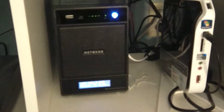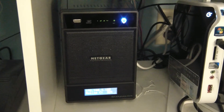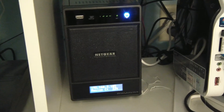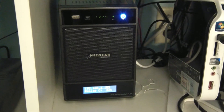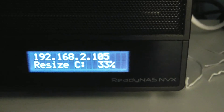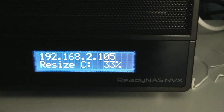What I want to show is how it behaves. Here's the beast right here. When you replace disks one at a time, like you're meant to, if you want to increase capacity — so you pop in one bigger disk, let it re-sync, pop in the next one, let it re-sync, all the way through the last one. When you're done, you reboot it, and during the next start-up it figures out that there's more space to use, and so it'll start resizing the root volume.